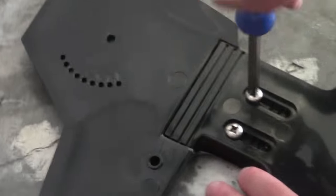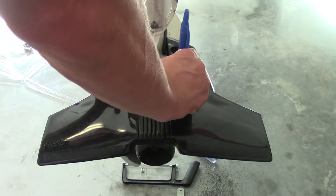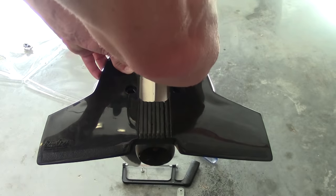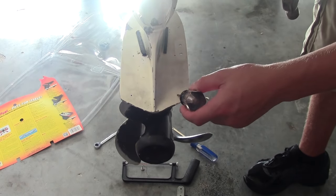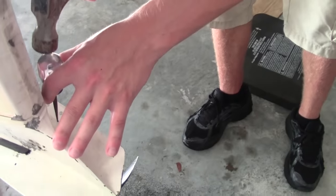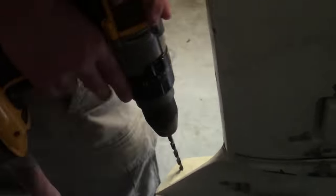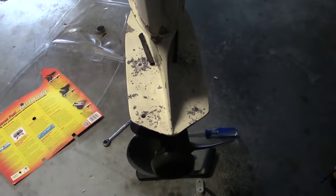Here I am putting it back together to get it lined up properly. Once you have it lined up and you like the position — as far forward as possible — you're just going to mark the holes. Make sure it's perfectly straight because once you drill those holes and put those screws in, you wouldn't want this thing on sideways — it might change the steering. I marked the four holes and I'm using an awl to punch little nicks in the aluminum so I can start the drill bit without it dancing all over the place. It's very soft metal, so just one little tap gives you a great starting point. Then take your drill, match the right size drill bit to the screws — I think this is a quarter-inch — and drill the four holes out.